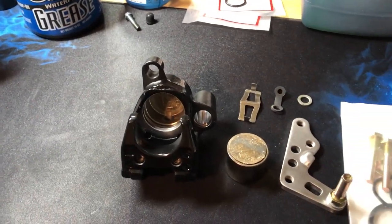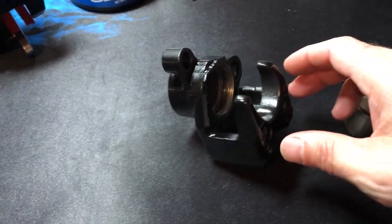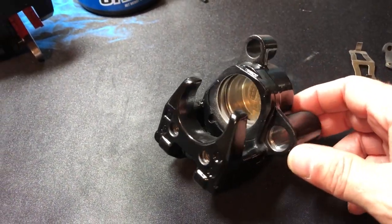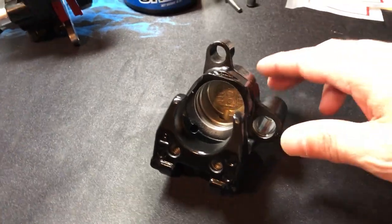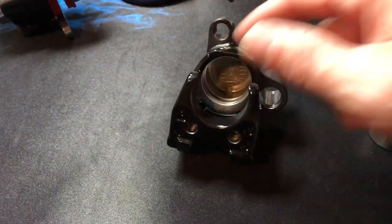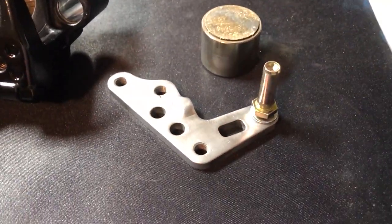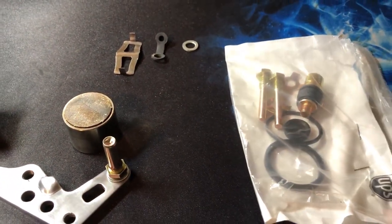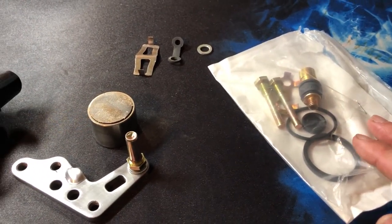So anyway, we're on to rebuilding the front brake caliper and this is the OEM one. I already painted this - we scuffed it up with some scotch-brite pads and wire wheels, got it all cleaned up, prepped it with some prep spray, and sprayed it down with some Dupli-Color caliper paint. It turned out pretty goddamn nice. We've cleaned out the inside with the Dremel and wire wheel, cleaned up the piston, got all the pieces. Look at that bracket - that's the OEM bracket, shiny and beautiful. And we got this - this is a cheap rebuild kit. I gotta stop doing this man.